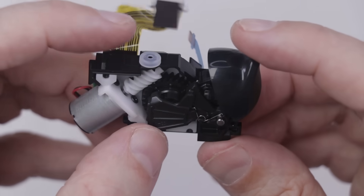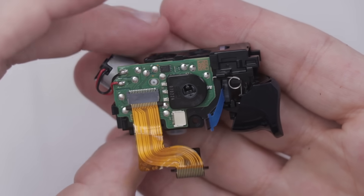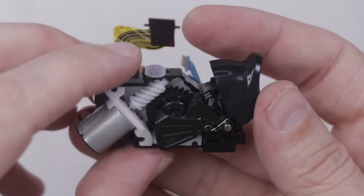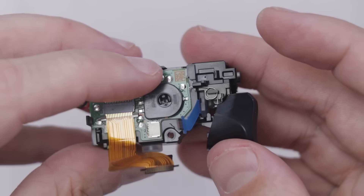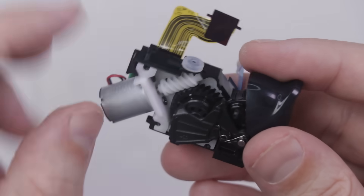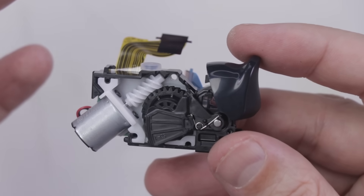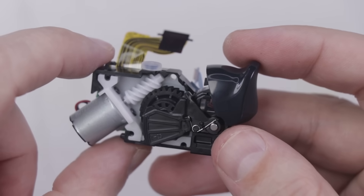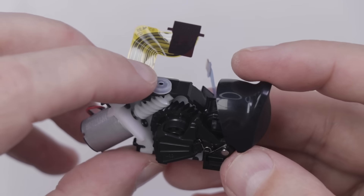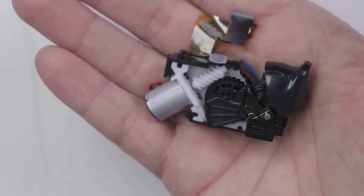One of the main concerns with a new system like this is the reliability and repairability. One of the nice things is that this is a modular piece — not only is this whole piece modular, it's also sort of modular inside itself. So this whole assembly, you could replace this piece right here, or you could replace this trigger button. You could even replace this potentiometer right here if needed, and even this control board right here could also be replaced. In addition, this whole motor and white piece can come out. The nice thing about this is the plate that goes over the top is just screwed on, so you can just remove the screws and get in and replace any pieces you might need to. It seems like most companies these days are just gluing this type of assembly shut so no one can get in and fix any of these pieces. There's also a dampener on this trigger system that helps to isolate any of the vibrations.